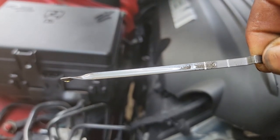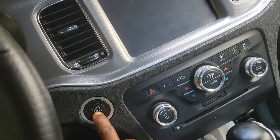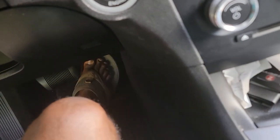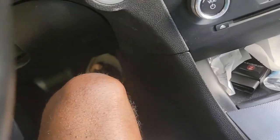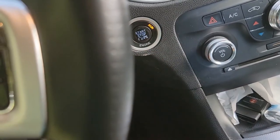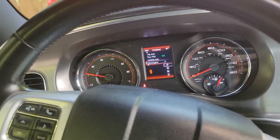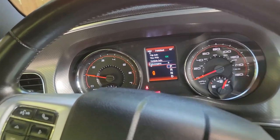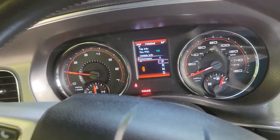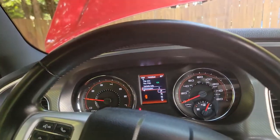All right, hope you have fun on your next oil change. After you change the oil, you're just gonna come in the car and turn your ignition on to run but not start. Then you push the gas pedal 3 times. 1, 2, 3. Then turn it off, and then we're gonna start the vehicle. From there, your oil life should change. As you can see, there are no messages. Zero messages. This is how you reset your oil life in a 2012 Dodge Charger. All right, see you next time.